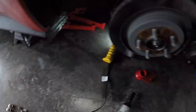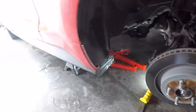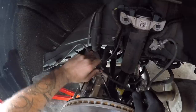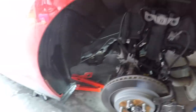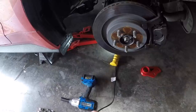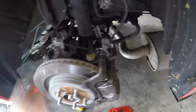When we do lowering springs, maybe I'll replace all the bolts then. We're going to undo the back shock — pull it out. You don't really have to take the sway bar apart or mess with your end links; it's all just going to drop free. But you have to take this loose first, then crawl underneath and get rid of the other stuff. Just to be safe, get this loose — it's a 13. Don't lose the bolts. Just let that hang — it should be fine. Get the other side done the same way.